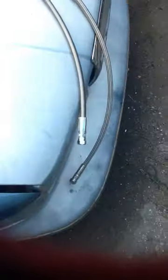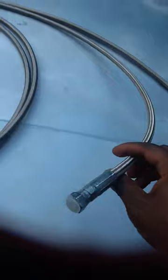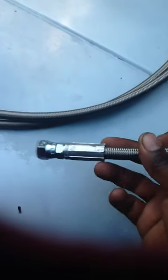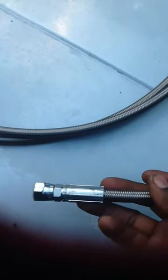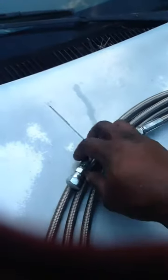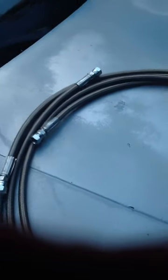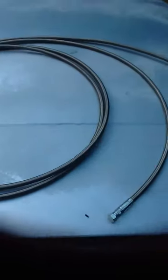We're going to show you the fuel line that I ran — running the stainless braided line with the JIC 37-degree flare, just like an AN fitting but it's stainless steel. The hose here actually has a Teflon core, kind of like a nylon line. I got this locally from Madshead, my friend Ben, the Madshead hose supply for $341. He made it.